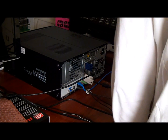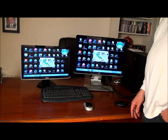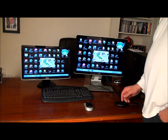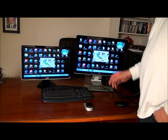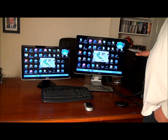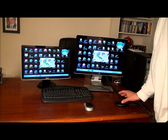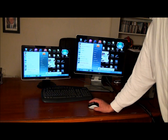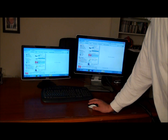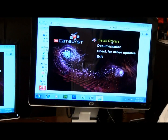Plug the power back in — we're ready for the smoke check. We've booted up the system, and one thing you might notice is that on the screens we have a complete duplicate screen. In order to stop the toggling, we're going to have to change the configuration. The video card we put in came with some software, and we just need to make sure it's all installed properly. We're going to go down to the ATI software that came with the card and go ahead and let that run to install the drivers.